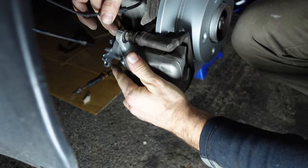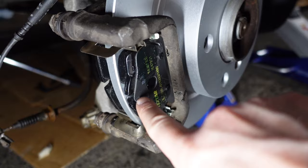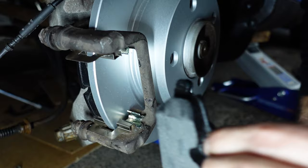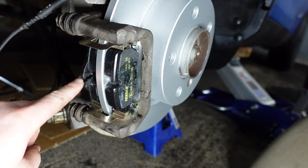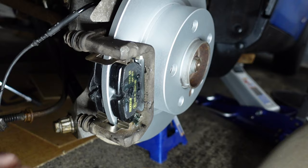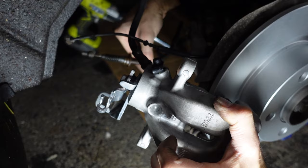Put a little bit of grease on the back side of the pads so we don't get metal-on-metal squeak. When sliding the new caliper on, it wasn't fitting — here's a quick lesson: we had it backwards. The pad with the sensor has a larger top to it and needs to go on the inside; the non-sensor pad goes on the outside. Slide them out, put them on the correct sides, and now the caliper goes on right.